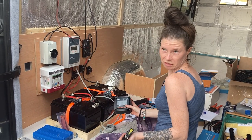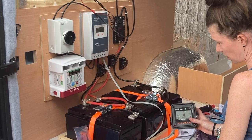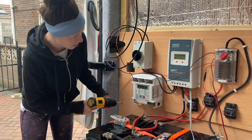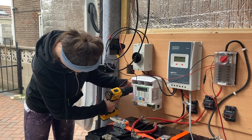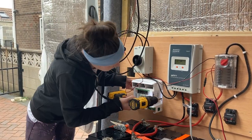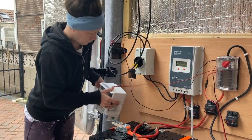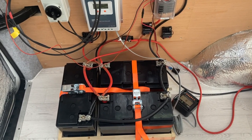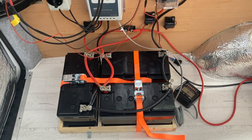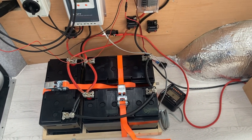If you watched our solar setup video, you'll have seen us putting in our control panel and fixing our B2B charger. But it's actually recommended you put the unit as close to the starter battery as possible, so the first job of the day was to relocate that. In order to get the juice flowing from the starter battery of the van into our leisure batteries, we've had to run the cables from front to back. Let me show you exactly where they're going to go.